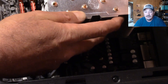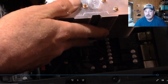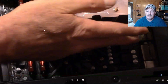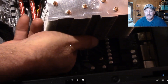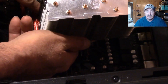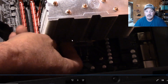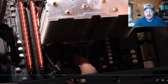It's a pretty simple, straightforward process to get this thing connected. Once I get the fan reconnected, I just run the fan cable underneath the heatsink itself back to the CPU fan header — just to make it look better. You don't have to do it this way; you can leave it around the outside, but I like my systems to look clean. Pull the cable through and plug the fan back into the CPU header on the motherboard.